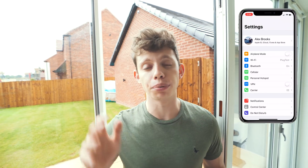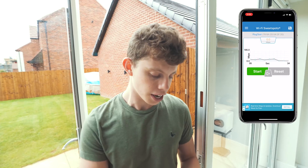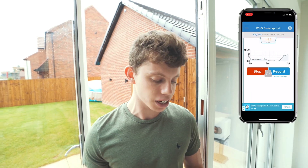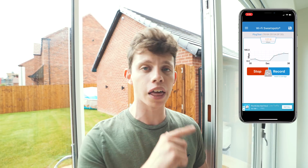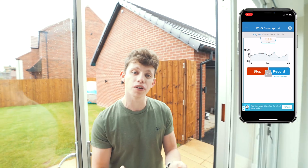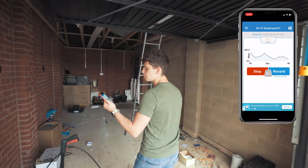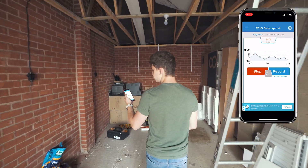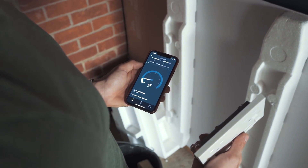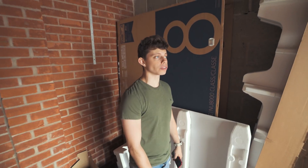On my phone screen now, I'm at the new house and I've created a brand new wireless network being broadcast by the access point called PlugTest. Using an app called Wi-Fi Sweet Spots, this gives me an accurate speed in megabits per second between my phone and the access point. As we walk out through two walls and into the furthest point in my garage, it's already dropped to 35, then 14. Running a quick speed test, we're pulling just about five meg — so the garage clearly needs some Wi-Fi.